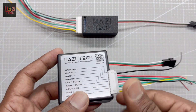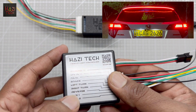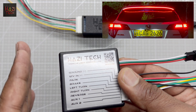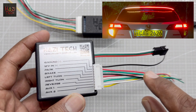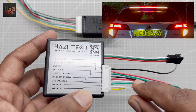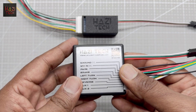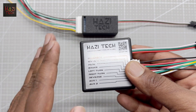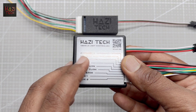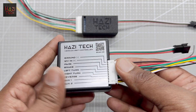The second key feature of this system is that the turn signal is automatically synchronized with the vehicle turn signal speed based on the signal. It will turn off the relevant part of the red park light area, run the turn signal animation, and then get back to the red light after the turn signal is off. Also, this system can work with 12 volts or 24 volts without any external converter or accessory. You can directly plug and use it, and there are internal protection circuits to handle input signal voltage fluctuations and to avoid any short circuiting.